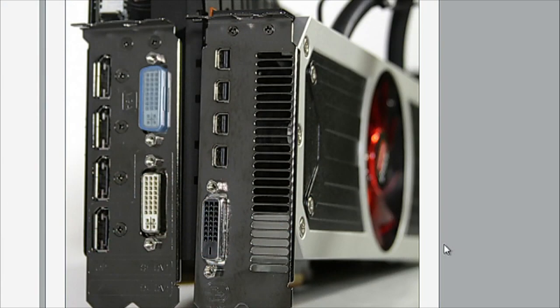If you look at the card itself, it only has two 8-pin power connections. PCI Express has specifications for power delivery and power draw — power supplies have to meet this, motherboards have to meet this, and all products that draw power are supposed to meet these PCIe specifications. The general rule of thumb: you get 75 watts through the PCIe bus itself, a 6-pin connector gets you 75 watts additional, and an 8-pin connector gets you 150 watts additional. So in theory, doing the math, you would only get 375 watts total through the two 8-pin connections and the PCIe bus — but if the card has a TDP of 500 watts, how do you do that? Where are they making up that difference?